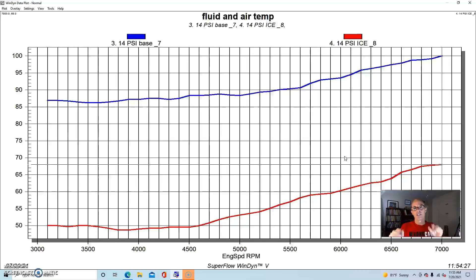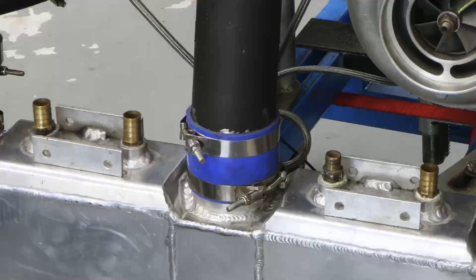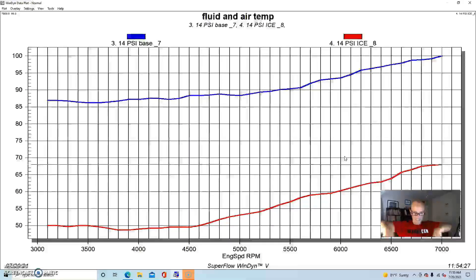One thing I don't like about this setup — and I think it's probably the pump we were using to circulate the water — is that we did see a rise in temperature through the run. I'd like to see it stay steadier. Also, the fittings in the air-to-water intercooler have the inlet and outlet on the same section of the core, and I'd like to see bigger openings and a pass-through design for better temperature drop. This intercooler isn't ideal — it's an inexpensive one from CX Racing — but we were able to make 1,500 horsepower with it.